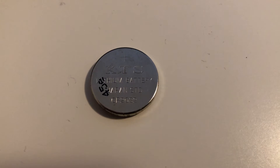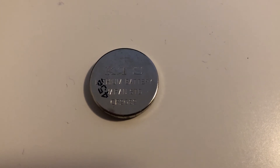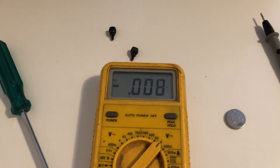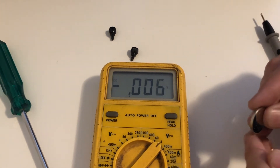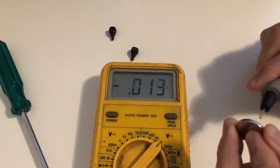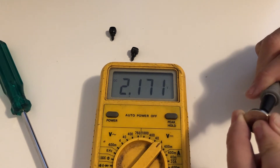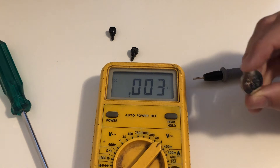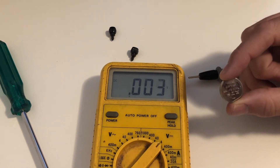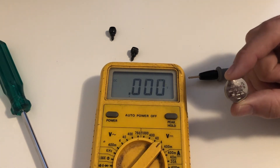It is a little bit hard to read, however you can see the BIOS battery that has come out is a lithium battery — a CR2032. This is what I expected; it's a standard BIOS battery. From memory this should read about three volts, so let's grab the multimeter and see what voltage this is putting out. You can clearly see this is reading 2.18 volts, whereas this little lithium battery should be up around 3 volts. So I believe that's clearly the problem with this PC on why it sometimes doesn't boot.